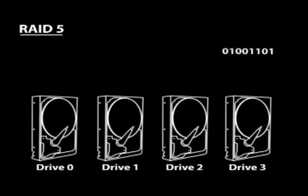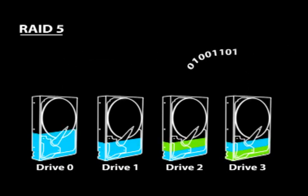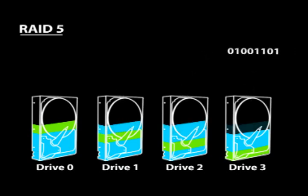The final method of hard drive configuration for D-Link products is RAID level five. Since it requires more drives, RAID level five is only available on the DNS 343. What it does is combine striping with mirroring — in this case it's called striping with parity. The parity bits can check the other data to make sure it's correct in the event of a hard drive failure. If one of the hard drives should fail, the other three drives can rebuild it, and you also gain the performance of striping. So if you have really critical files that are really big and you need to get to them quickly, RAID level five is what you want. Here at D-Link TV, that's what we use for saving all of our videos.